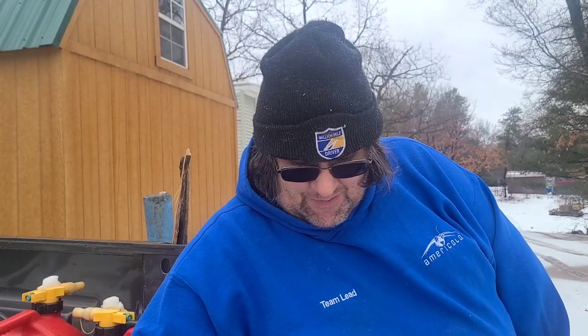I may have some other videos to film I can do here. Next time you see this saw running, it's going to be in the basswood — I've got to get the ash cut up first. I won't have to sharpen the teeth; I'll just do a quick fingertip check to see if it's still sharp. In basswood, as easy as it cuts, I might be able to go three tanks on a sharpening. In oak you may have to touch it up every tank of gas — two or three light strokes with a file — especially because it's more abrasive. And if you have dirt in the logs, that's going to wreak havoc with your chain sharpening life.